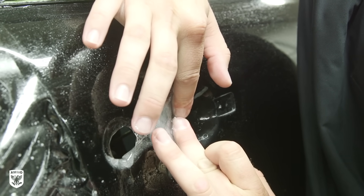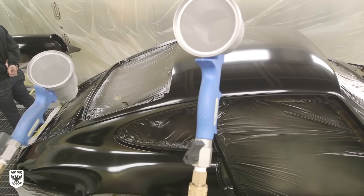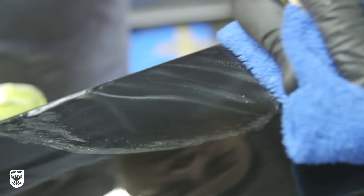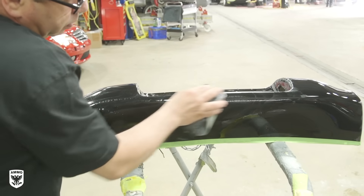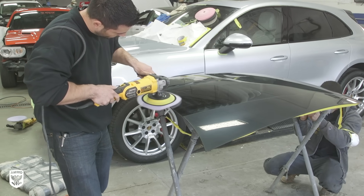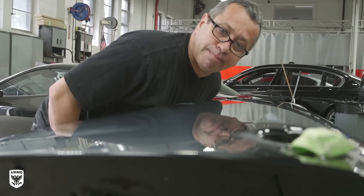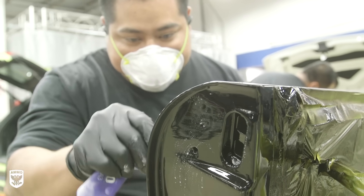The important takeaway is that the paint will be ready for waxes, sealants, and even a clear bra after about a week. Now, in most body shop situations, seven days is not normal because they don't sand, paint, and bake multiple times. That repeated sanding and baking is what helps the gases come to the surface and release from the paint, decreasing the normal waiting period from 60 to 90 days. Most body shops don't take the time for this many steps — it's not economical for an average daily driver. But for a concourse paint job, these extra steps are what make it unique.